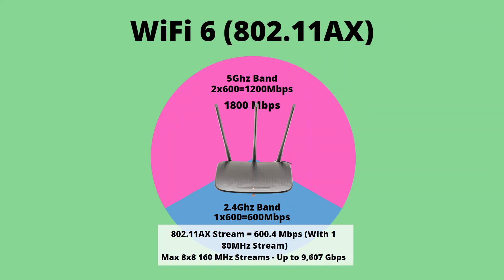With Wi-Fi 6 the trend continues. The Wi-Fi 6 signal is actually only about 40% faster than Wi-Fi 5, but with the ability to support as many as eight spatial streams and increasing the channel width, you get another exponential jump in performance. Keep in mind that in order to realize the advantages of Wi-Fi 6, you want to have a Wi-Fi 6 device or get an adapter that supports Wi-Fi 6. Personally, I would wait until Wi-Fi 6 devices become the norm before buying a Wi-Fi 6 router. I've never been one to rush out and spend all my hard-earned money on the latest and greatest when prices will eventually come down as the technology moves forward.